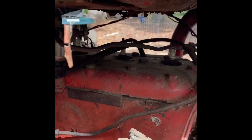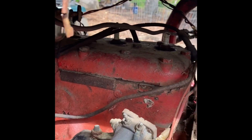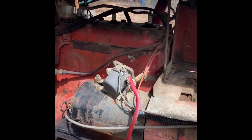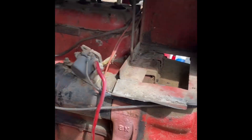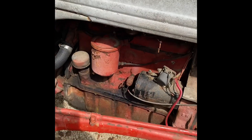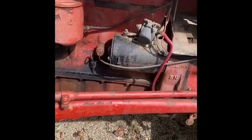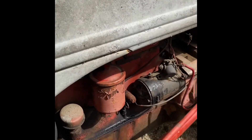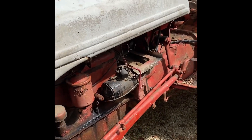Pretty much just need to throw the battery in, crank it over to get the mystery oil out of the cylinders, then put some fuel in it, put the plugs back in, and fire it up. But we've got to go eat a little Labor Day lunch with the family, so I don't know if we'll be back on it later this evening or maybe later in the week.